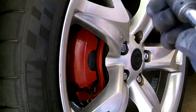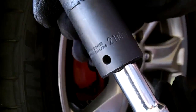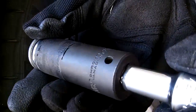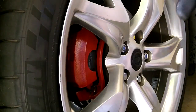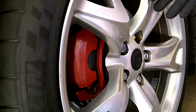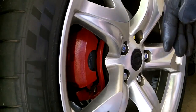You can take a look at the hole on the socket, put it at the top, and count how many times you see it revolve around. Then multiply that by 1.5 — that's how much thread engagement you have with your particular wheel, because it can differ depending on the wheel. Every wheel has a different thickness at the mounting point.